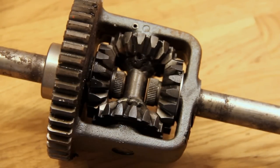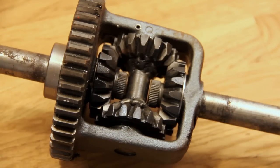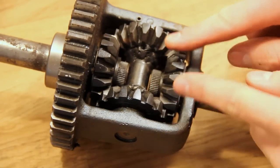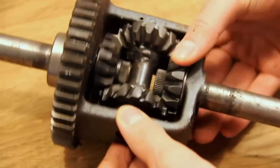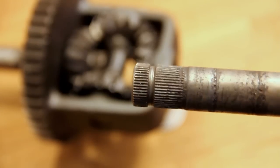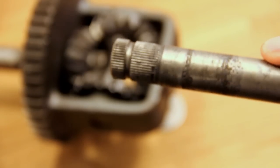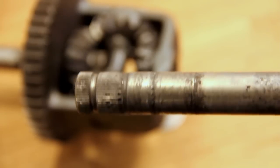The problem is that when the ride-on mower is moving, the wheel with the least resistance will move, especially in slippery conditions. Because the spline on this half shaft has been stripped, when this side has the least resistance it's supposed to turn, but it just spins inside. The spline is meant to engage into grooves inside the spider gear and turn it, but it doesn't. Here's a closer view — you can see the damage, and there is further pitting along this half shaft, meaning there has been rust and other debris inside the gearbox.